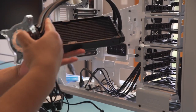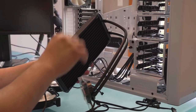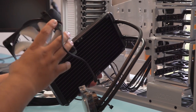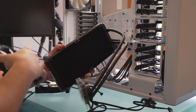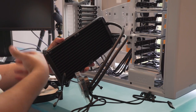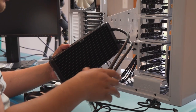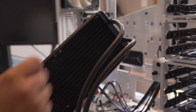The cooler we've gone with is a pretty brand new closed-loop cooling solution — some people refer to this as a water cooling unit. It's not a full custom water cooling setup; it's pretty much already been set up for you. This is an ultra-large 280-millimeter unit from NZXT — the Kraken X61. It's a very high-performance unit with large-diameter fans that keep it cool but also very quiet, which is a key target. We don't want the system to be loud. It has a variable pump that allows it to run much quieter, and it's got flexible hosing compared to earlier rigid closed-loop solutions.